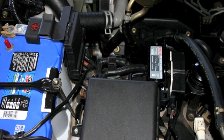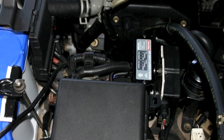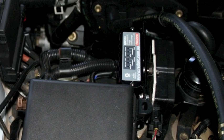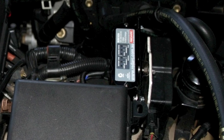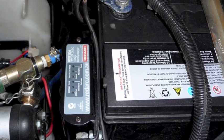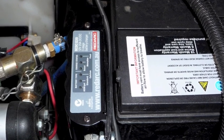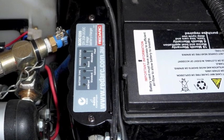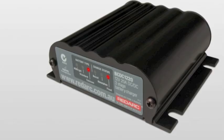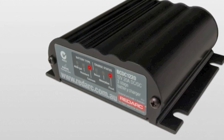Now the amazing thing is that as long as I'm driving every three days all my batteries are running. I'm running a 110 litre Waco fridge freezer and another 60 litre Waco that is a freezer in its own right. Three days, there's no problems — as long as I'm driving within three days it all charges up again. So basically instead of charging the batteries directly off the alternator, the alternator voltage goes to the input of this thing and the output goes to the battery, isolating the batteries but still charging them. It's not sucking all that power out so it's all very well controlled. It's actually called a Redarc Smart Start and it's a BCDC 1220.